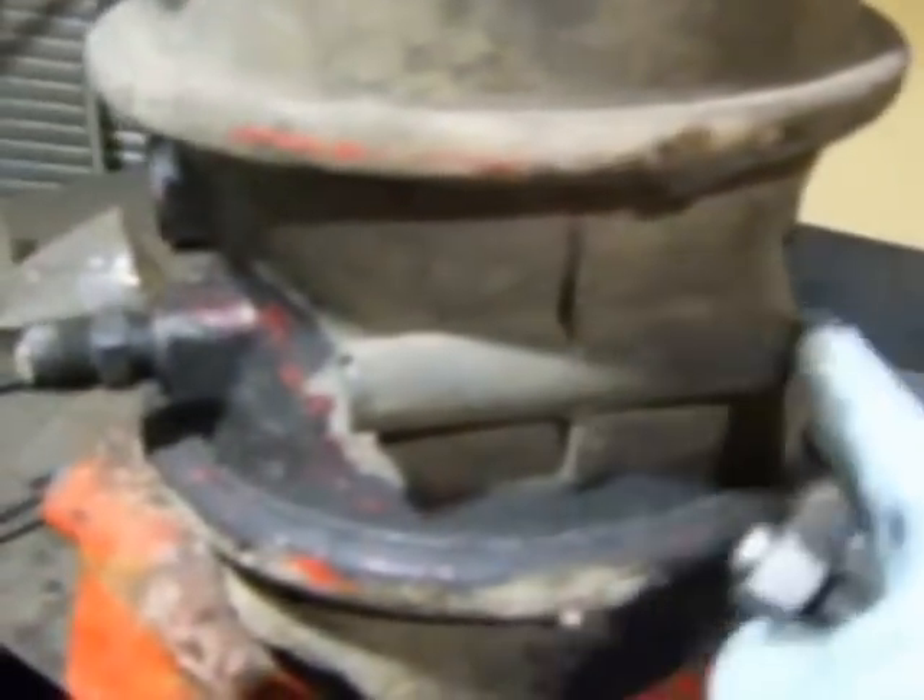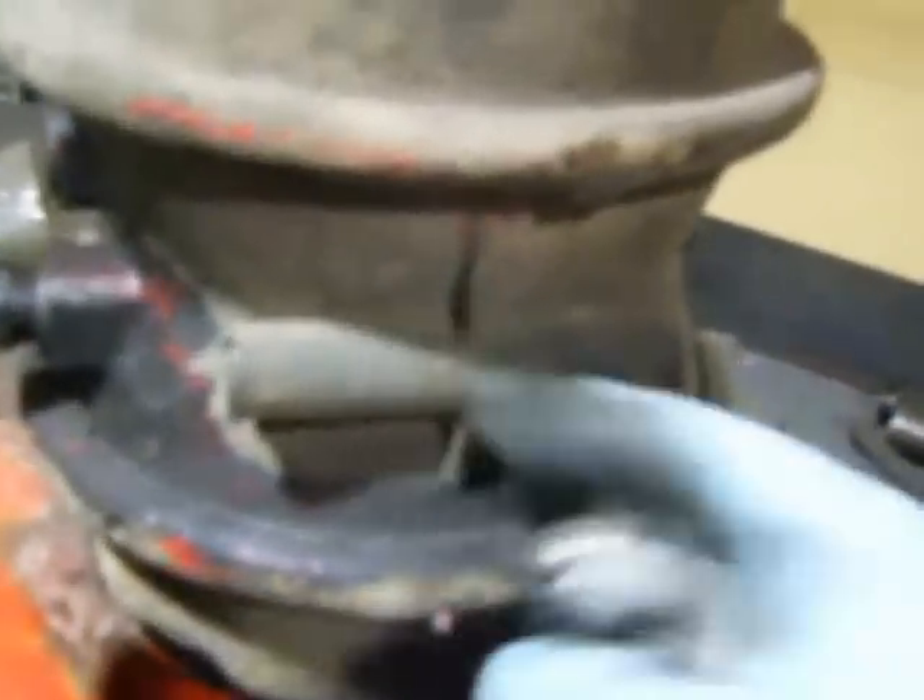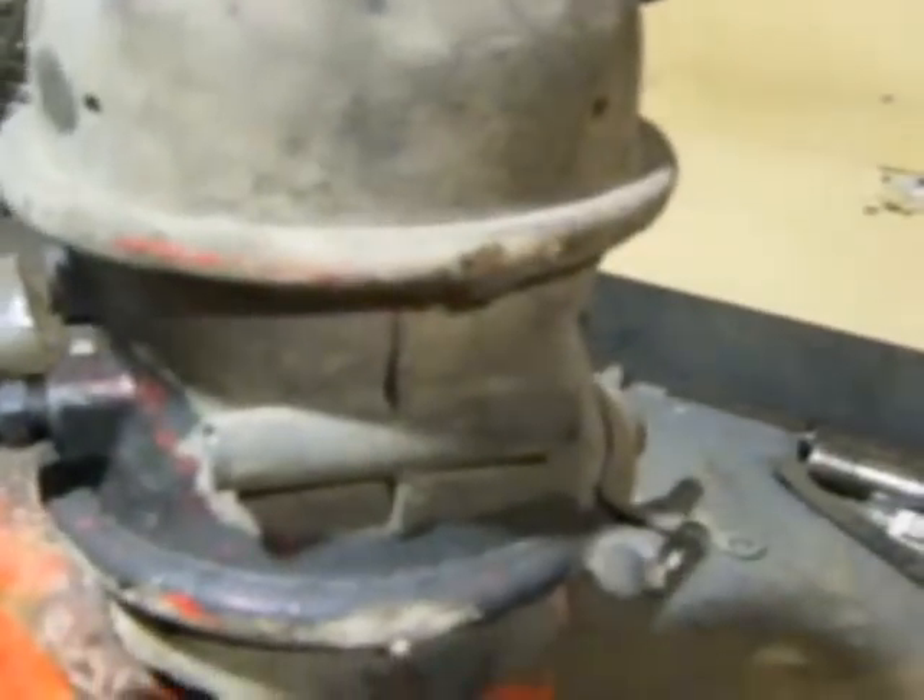This is a spring brake tool. They can usually be found on the side of the spring brake canister — there's a holder for them. I generally don't leave them in there; I usually take them out and put them in my toolbox so they don't get seized up. Like this one here has a tool in the side of it, but it froze up inside and is of absolutely no value. You'll break the side of the canister before you get that tool out of there.